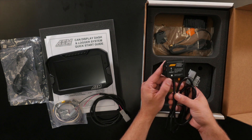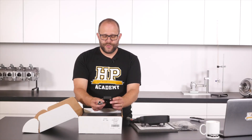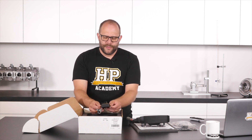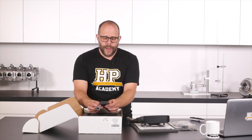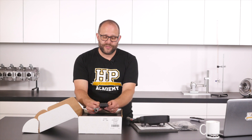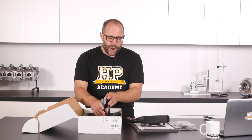This is a really cool piece of gear — it's the optional VDM or vehicle dynamics module. It's a three axis accelerometer and GPS unit all built into one pretty tiny little package. It gives you information as to the pitch, roll and yaw of the vehicle, along with acceleration data along the car's three axes — that's front to back, side to side and up and down. This data is pretty critical when you're trying to dial in a suspension setup, and for verifying any changes you've made. It's also a GPS module, so it gives you real time track mapping and position data, which is really handy when you're looking at that accelerometer and gyroscope data, because you can tell exactly what corner the car was in at the time. They've broken the wiring out into the AEM net pinout and given you both a male and a female connector, which makes it really easy to interface into any part of the wiring harness.